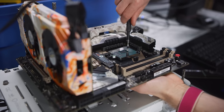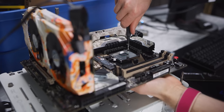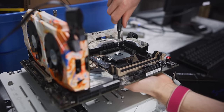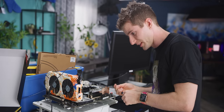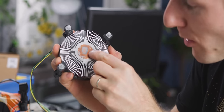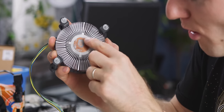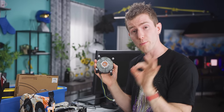Just a little bit of thermal compound — you really don't need a lot on these bare dies. Even the amount I put on before almost all gooped up around the edges. The good news is that means our mounting pressure was pretty spot on, which means the height of their adapter is about right.